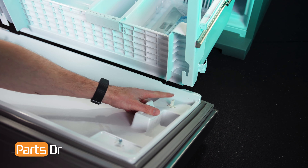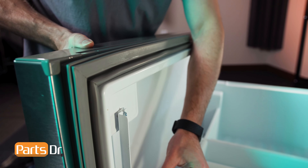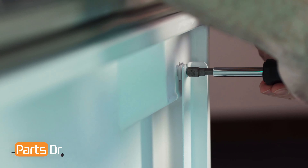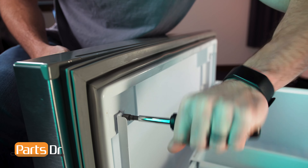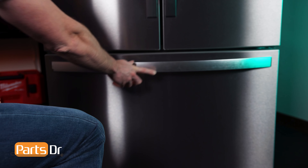To install the freezer door, align the hanging tabs near the bottom of the door to the slides and the bolts to the notches on the hanging struts. Once the door is seated properly, tighten the bolts. With everything put back together, plug the refrigerator in, test it out, and make sure everything's working properly. And that's it for this video. If you learned something new, hit that like button. And if you enjoy fixing things and want to see more videos like this, please consider subscribing.